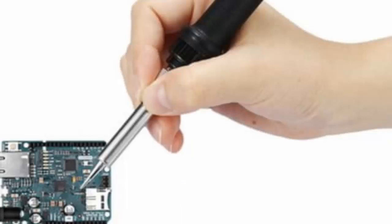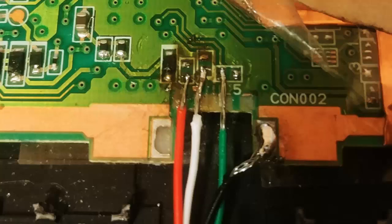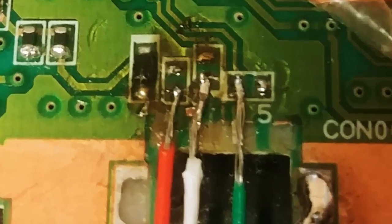As I've mentioned before, I am not an engineer and I have no prior experience with soldering. As such, I did a great deal of damage to my board in the process of attempting to make this repair, and unfortunately I destroyed all of the components soldered to this part of the board. I am making this guide in the hopes that nobody repeats this mistake. However, if it does happen, functionality can still be restored by removing the destroyed components and soldering directly to the pads.